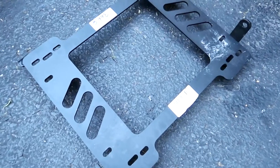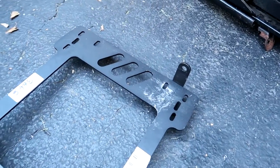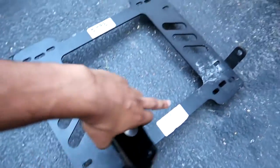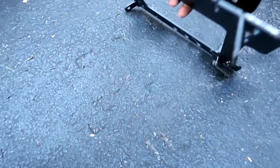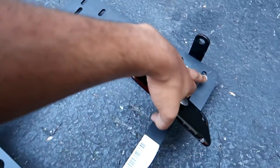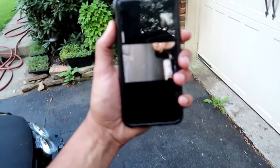This is the actual seat bracket. There's the seat belt mount, and all these little holes where you can position your seat to different specifications. For some reason there's not much adjustment play with this seat, so the bolt position you really want to use is the middle one of the three cutouts — same thing on each side. Use the middle cutout on all four positions to bolt up your seat.